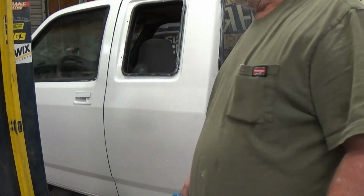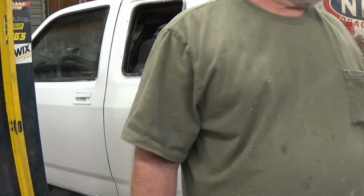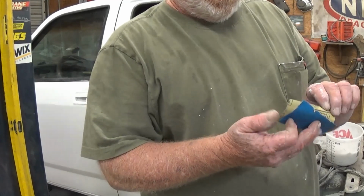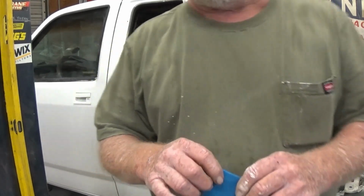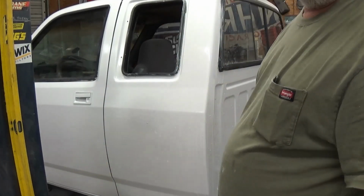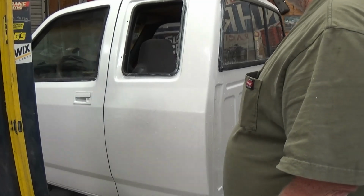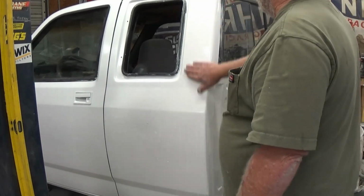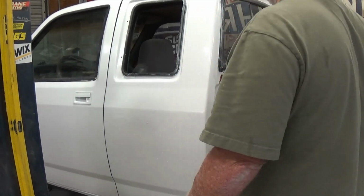We painted this thing with Rustoleum gloss white. We mixed in the Japan dryer and catalyst hardener, and cut the paint with acetone, so it kicks off fairly quick. But it's dry enough to color sand anyway. So we're gonna go over it with some water paper and 600 grit, and knock the top edges down, and then we'll come back with some 1000 or 1200 and do the fine. But it'll slicken it right out anyway.